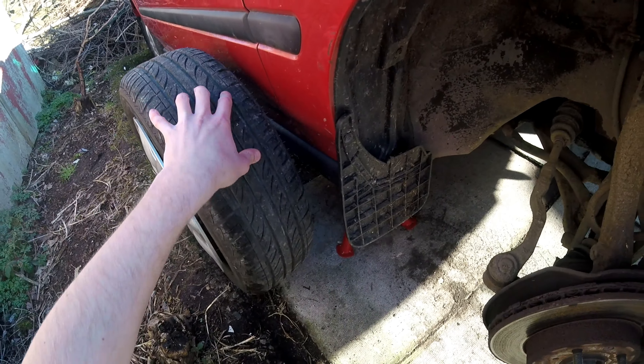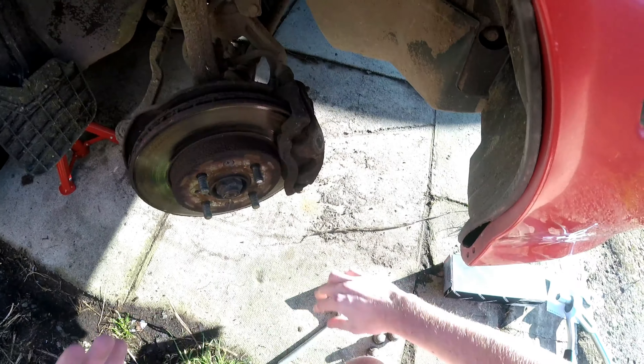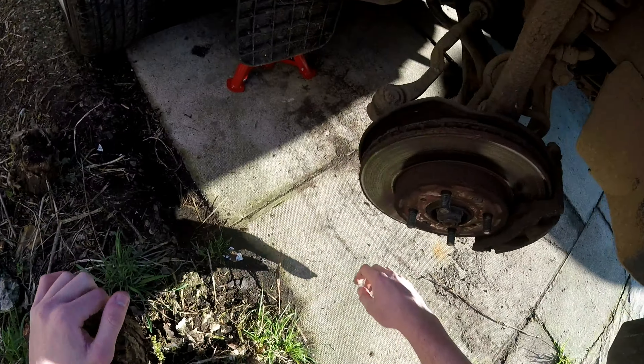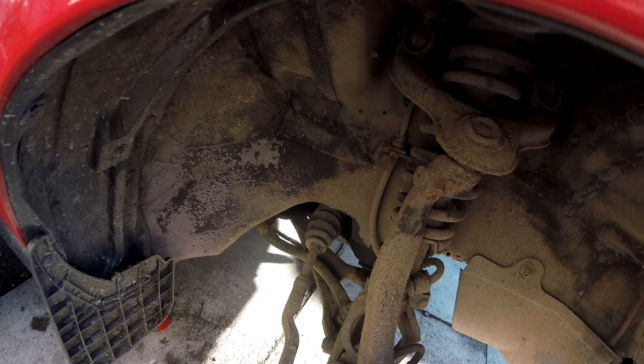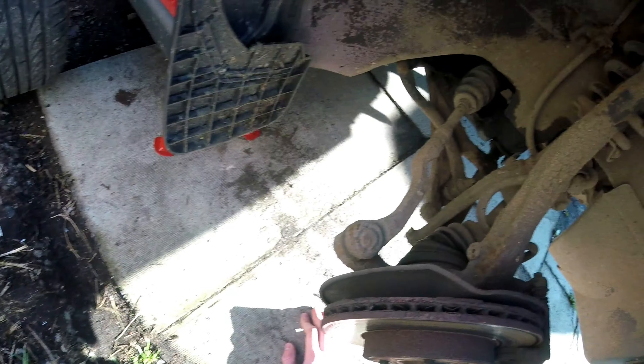And then here you can very clearly see that there is clear access to this track rod, and then we can give it a full assessment. Already I can see straight away why this has come up as an advisory — it's clearly rotten, the rubber's probably starting to split. You can't really see it on the video, but there where my finger is, it's starting to split. So it is fairly obvious that this wants some attention, as does probably the rest of the car at some point, because I know the history of the car — it did come from a farm, hence all of this mud. So that's our issue there, let's get cracking on.